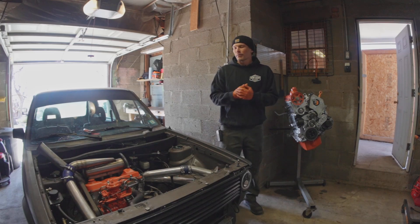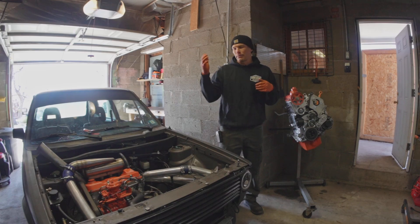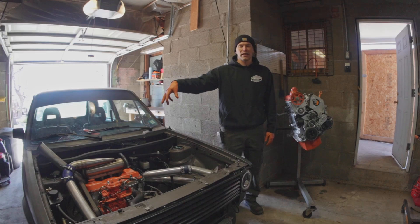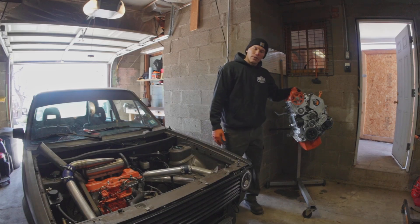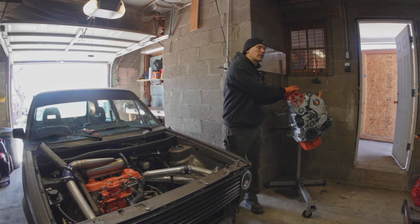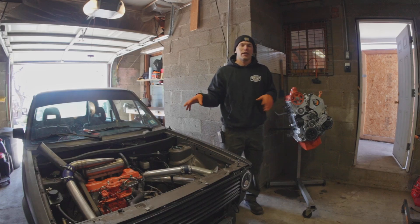The rest of the swap will look like this: I'm going to be pulling the fuel pump out of my 1.6 and swapping my 1.9 liter Bosch pump head into it, because it has a Hans Auto Parts pump head in it right now which is questionable. I'll also try to move the pressure regulator from my 1.9 pump to the 1.6 so it can be a full MTDI pump with the proper case pressure. Once the fuel pump is sorted, I'll be pulling the 1.6 head because my ARP 2000 head studs are currently holding the 1.6 head on the 1.6 block, and right now I just have a couple of non-ARP-2000 studs holding this head in position gently. Then I'll be yanking the rest of the 1.6 out of the engine bay and completing the swap.